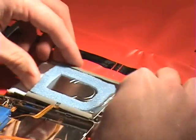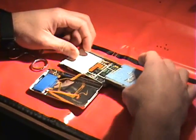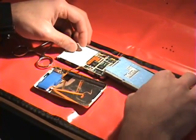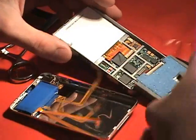Flip it over and lift the hard drive up and rotate it back this way. Now disconnect the ribbon right here — there's a brown part on it that you just want to flip up, then pull it out. Now you've got the back part disconnected.